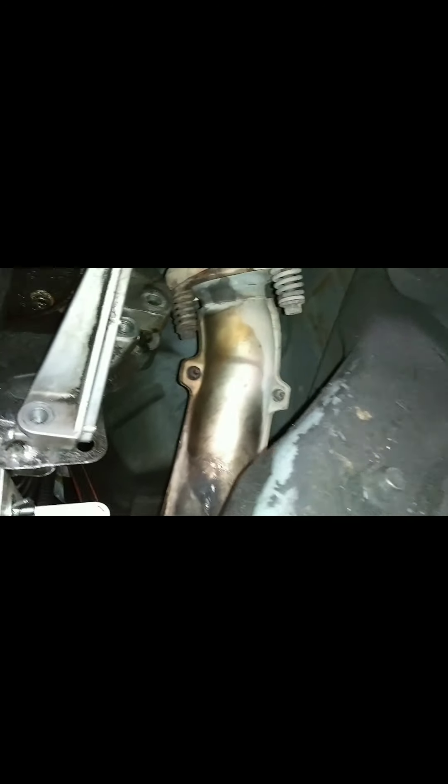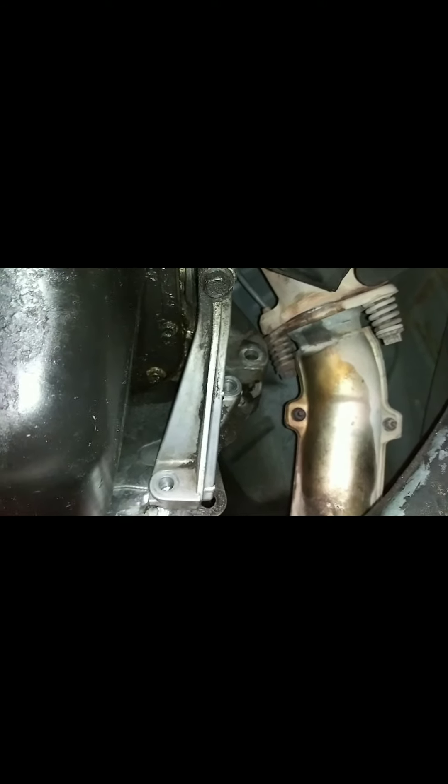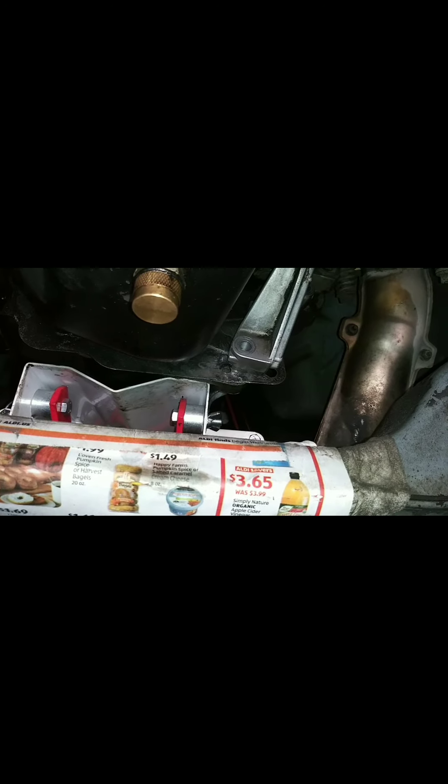On the L bracket, I took out two 14mm bolts connecting to the transmission on the passenger side, two 14mm on the driver side lower, a 17mm nut on each side at that third hole up, and one threaded bolt up top. Then two 17mm bolts on top and two 10mm on the flywheel dust cover. Unfortunately, somebody had previously worked on my car and screwed up a bolt, so I had to grind that one out — it took a really long time.